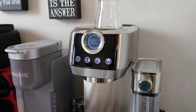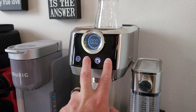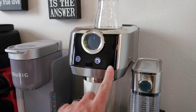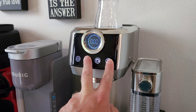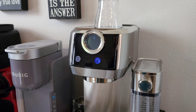Now we're going to set the temperature. What you do is hold down the espresso button and the latte button at the exact same time for five seconds. Now we've entered temperature mode. Low temperature, medium temperature, and high temperature — we're going to hit the latte button to set it to the hottest temperature this machine can offer. If you want to change it back, press the cappuccino button — that is medium, which is the default setting. Simple as that.